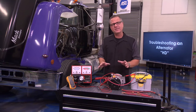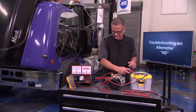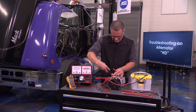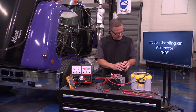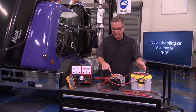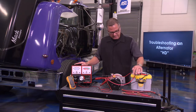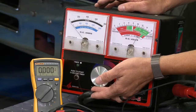Just as important as the positive side is the negative side voltage drop, and a lot of people forget that — because the electrons have to run home through the case. To do the negative side, I take the lead to the wire on the negative side and then come to the negative post of the battery — negative to negative. When I put some load on with the carbon pile, it'll pull the amps through that wire so we can make sure the connections are good and there's no voltage drop from the alternator to the battery.